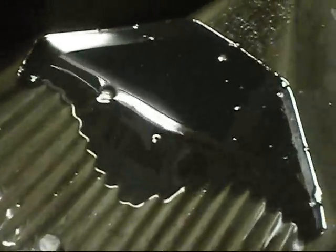Now, this is the magic slop that came out of the fuel tank. I rang the customer and went blah blah blah blah. And he says, oh, there should be real diesel in there because he had been running biofuel. They flushed that all out and put real stuff in, but I think this is like the skin of shit that builds up on everything from that biofuel. And the diesel's washed it all out and now we got more rubbish. But this problem started many months ago on biofuel. So I've told him he's probably fucked his pump.